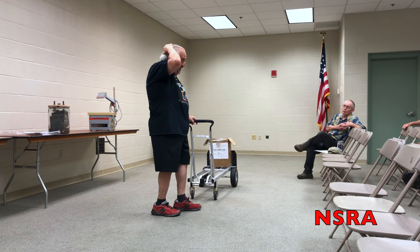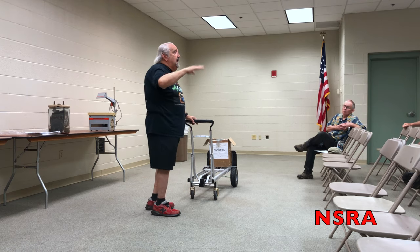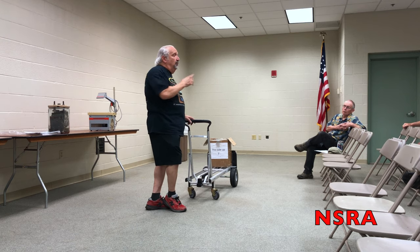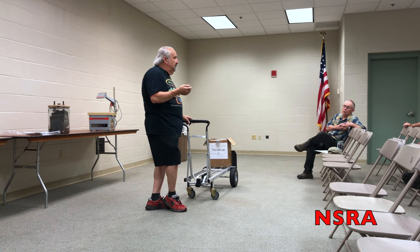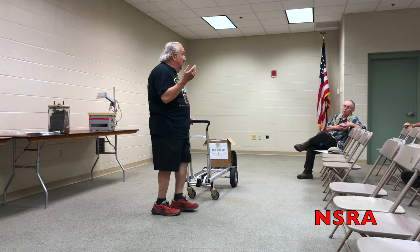And most everybody understands that a deep cycle battery is slightly different. What a deep cycle battery is designed to do is be able to go down in voltage lower and not get hurt. A starting battery wants to stay above 11.7 volts always. And 11.7 volts sounds like it's still pretty good, but I tell you what, 11.7 volts may not start a car. A battery's got to be in the 12 volt range for most cars. At 11.7, modern cars with electronics may not fire.